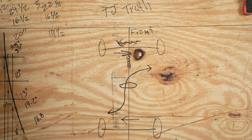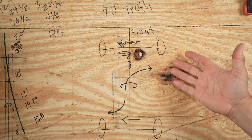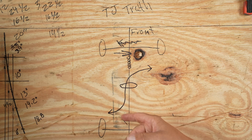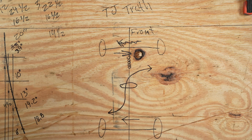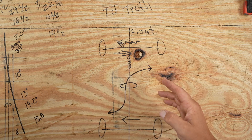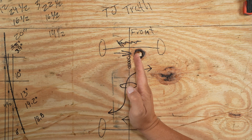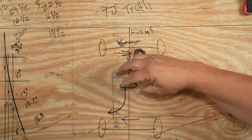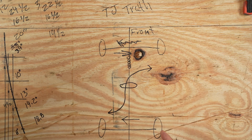The TJ and LJ live by these laws because of their four coils. I believe the JK and JLs are set up the same way due to having opposing track bar angles. The reason they have opposing angles is that when you hit a bump, it's not trying to kick the whole body over — it's just twisting the body slightly when it goes over a bump, as opposed to trying to move the whole mass over. That's why I think they've done it that way.